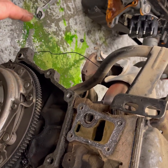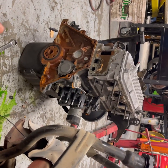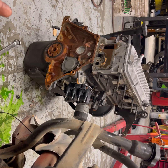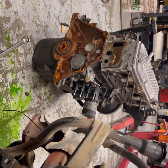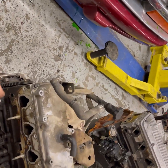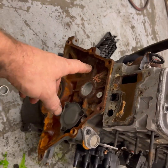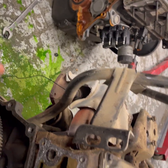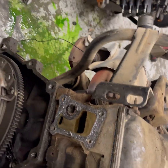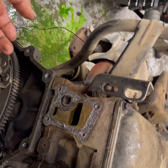From what I've seen, somebody else did a video on this and said they got it to work. I had a 97 Chevy Cavalier motor, low mileage, good — I was going to put it in here. But the main problem is the cylinder head. The ports in the head have a different port style, so the S10 manifold is not going to go on there and seal up correctly. Then you have the coolant port in the back of the head with EGR. On this one, the cylinder head is so warped, and I'm afraid if I spend all this time resurfacing the head and putting it back together it'll seize up right afterwards, so I'm not going to do that.